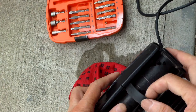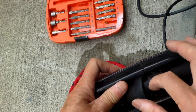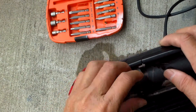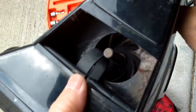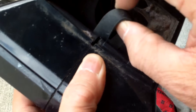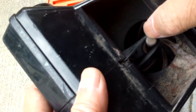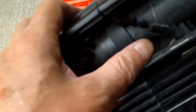Put it back in here and push it all in. With the vacuum cleaner facing you, the belt is slightly off-center to the left. When you try to put the belt back on the shaft, you turn the belt to the left like that. If you flip the belt the other way, it'll come off when you turn on the motor.